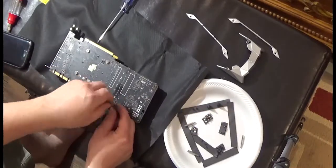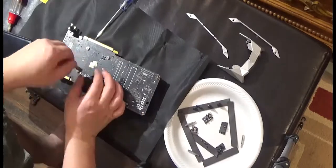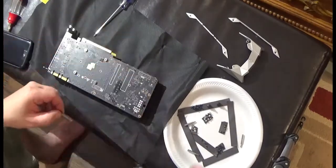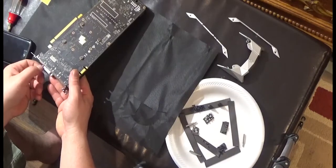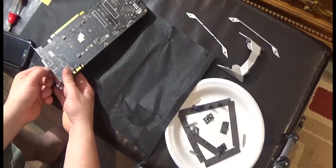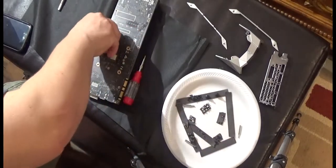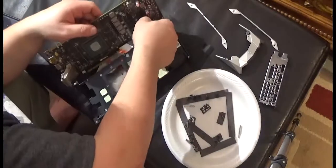You've got a couple more screws on each side to get the back plate off. This is where you're going to need to use your 5/32 hex tool. I couldn't find a handle for it but I was still able to loosen them. Everything on this board is pretty easy to take off — nothing has been torqued down real heavy. So when you put everything back together, make sure you're not over-torquing anything because it will snap. There are close to 15 hex screws. Then remove the four tension screws and unplug the fan cable carefully.